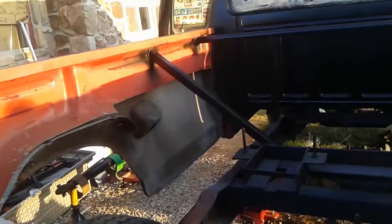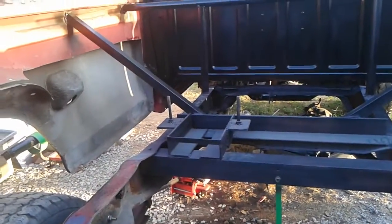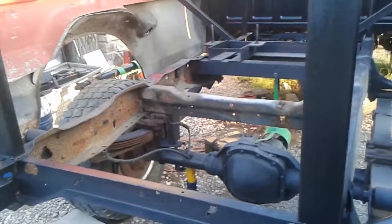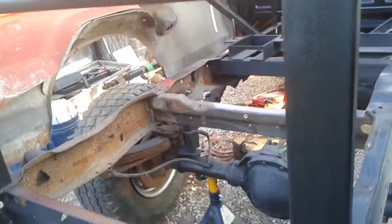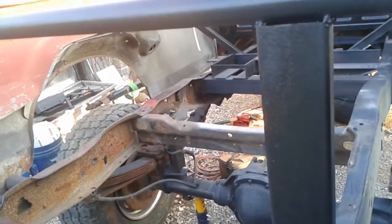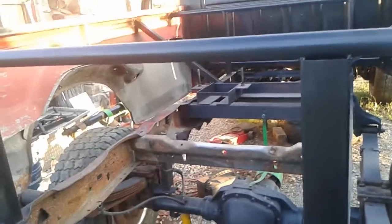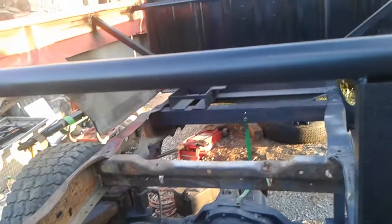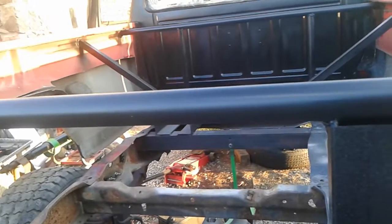We'll have a straight piece of cable in there, so we can shut it off from outside of the truck. That will be one of the safety features on it. Two, there will be the safety cable back here in the rear of the truck that the sled cable hooks onto. If the truck were to release from the sled, say the hitch would break or by some chance the chain would break on the sled, the truck will shut off immediately. It will cut all the power to the truck and we will get it stopped. And also, in case a fire breaks out, if something happens that would catch fire, we'll have a full extinguisher system in the truck.